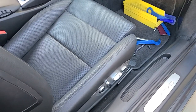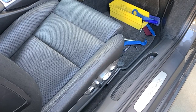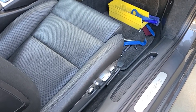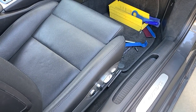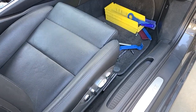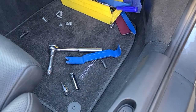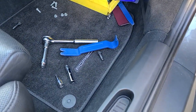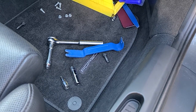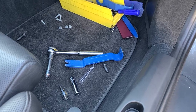In this video we're going to show you how to remove the amplifier from a Porsche 911 2012, which is similar to some other years. The amplifier is located under the passenger seat in the front. The tools you need are a 10mm socket, a Torx screwdriver size T30, and an E socket size 14.